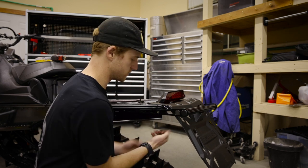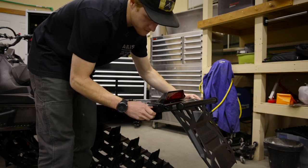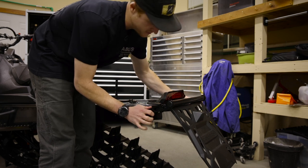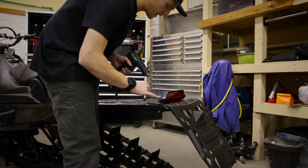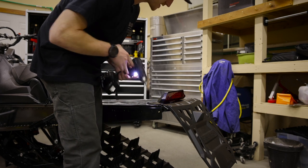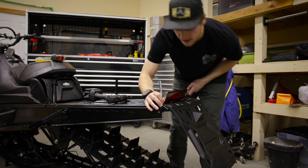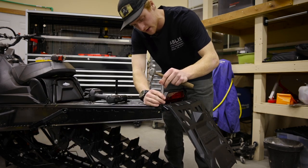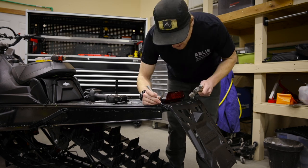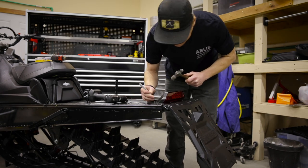Remove the bumper, drop bolts everywhere. We're also removing the taillight — 8mm bolts. Then grab a fresh 3/16 drill bit to rip all these rivets out. Pro tip: the nail on the rivet is steel in a lot of these, so it's nice to knock that nail out or down first — it can be a nightmare otherwise, but it'll make it so much easier to drill.